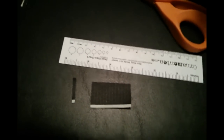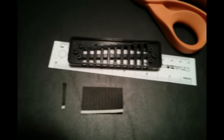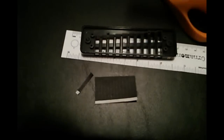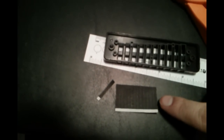And I actually decided that why not actually measure the distance in the slot, and also why not measure the actual size of the reed slots themselves and find a reasonable size and then measure it out on the piece of valve material, draw nice straight lines with a ruler and cut it this way. So if you're wondering what size I came up with, it is an eighth of an inch, okay?